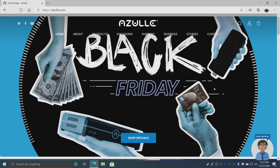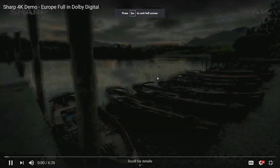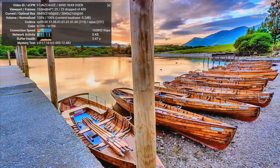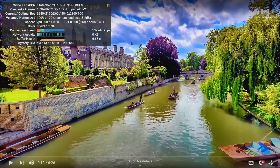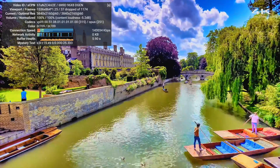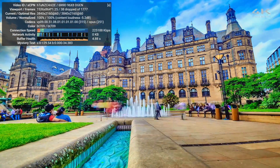I've been able to do 720p, 1080p, and even 4K playback. Heading over to YouTube for a 4K video — on the initial load-in you will see some dropped frames; we're sitting at 23 dropped out of 500 frames right up in the top left corner. But overall, 4K video playback is possible, and if you didn't have that frame counter on you'd never notice the drops. I've had really good luck on these J4125 CPUs with 4K video playback, whether streaming from YouTube, Netflix, or even Plex.